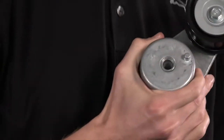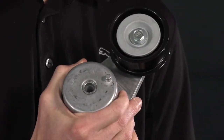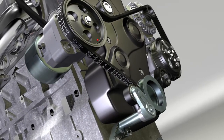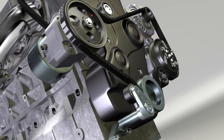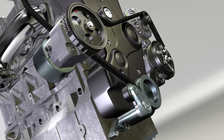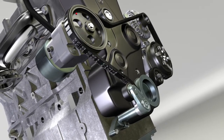The typical reaction to this problem is to just replace the tensioner pulley. However, that's not the best fix. You should consider that the other components of the tensioner may have already surpassed their service life, and it's only a matter of time before they fail. For this reason, you need to replace the entire assembly, including the tensioner and belt. The majority of the cost is in the labor, so it makes sense to replace everything at the same time.